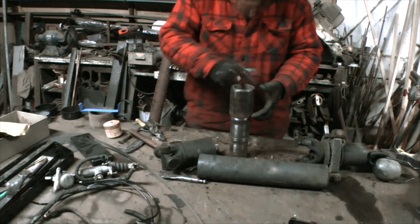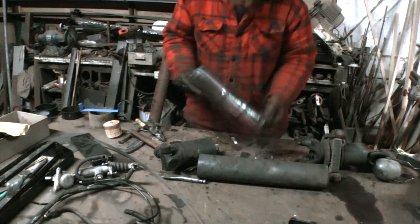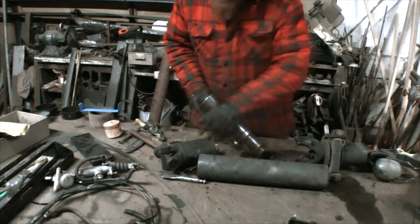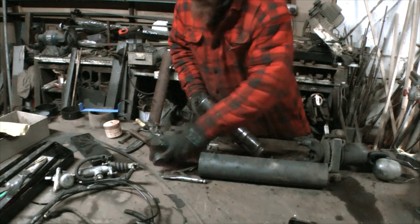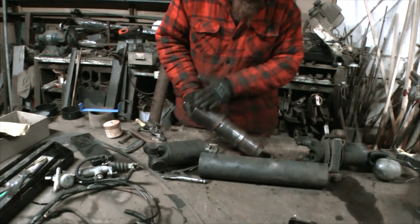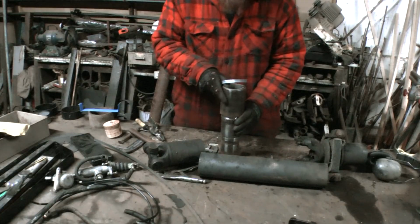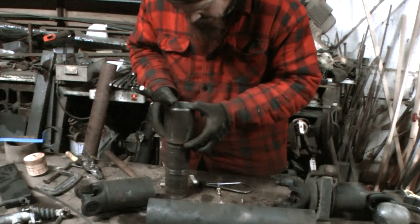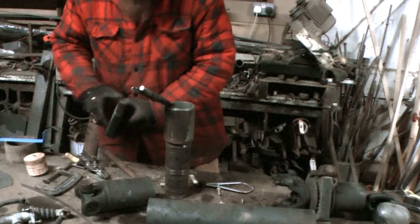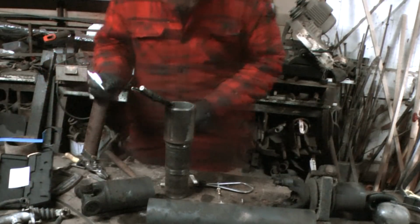So I'm going to weld round here, and then remount this in the lathe and turn down this sleeve until it sits inside here. And by that point, this should all be nice and square, sit in there, everything will be hunky-dory. That seems rather close. Break out the posh verniers for this.